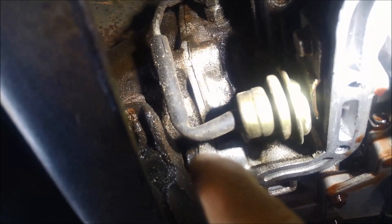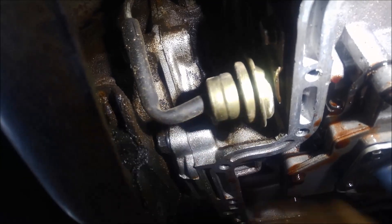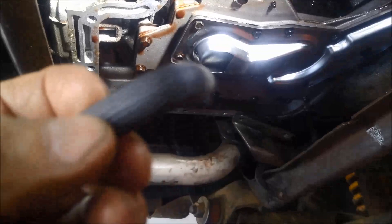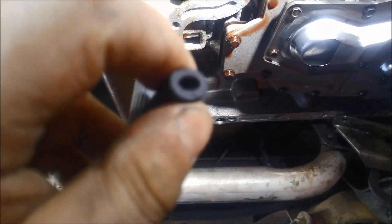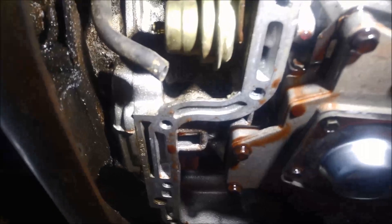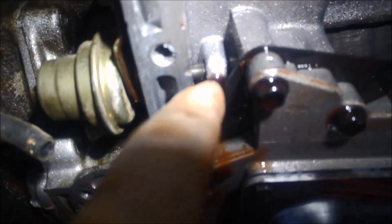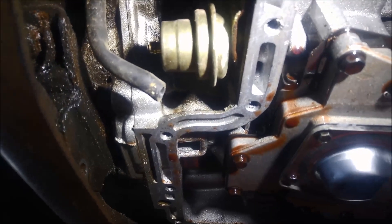On the vacuum modulator, someone's just put a straight normal hose on there and it's actually not a vacuum hose either. You're supposed to use these — they've got a little elbow in them and they're hard rubber, very hard to collapse under vacuum. You just pop the modulator off like that. You can see someone's screwed the adjuster right out — they want it to upshift a lot sooner and softer. If you want it to shift a little bit higher and harder, you actually screw that in. But if you go too far, the little modulator valve will lock up and won't be able to travel. Once you get to that stage you've just got to back it off a little until you get a comfortable shift. When these modulators are no good they leak — you'll suck oil out of the transmission and it'll go straight through the inlet manifold and out your exhaust. This one's not leaking so we'll leave that one. Sometimes you'll also find a bit of fuel vapour there, which is an indication you might need to tune up your motor.